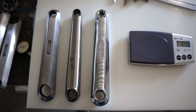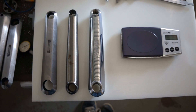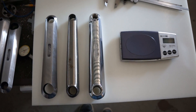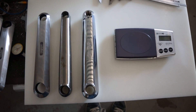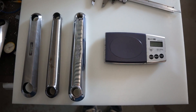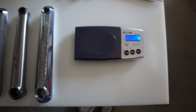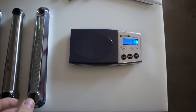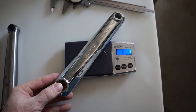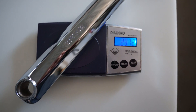So it's not a very strong design, but they are fast and cheap and easy to make. The aerospeeds have a lot more work involved in them, but they're also a lot stronger crank. Now strength is great, but we also wouldn't want that to be at a compromise of weight. We're going to show that the aerospeeds are actually even lighter than the swag tube crank arms as well. I'm going to turn on my gram scale here on the right. We're going to take a finished 180 millimeter chrome plated aerospeed arm — we're at 297 grams.